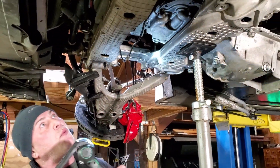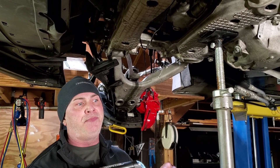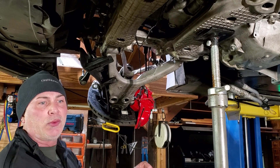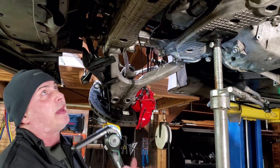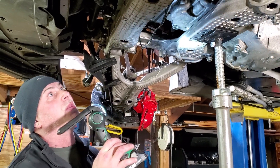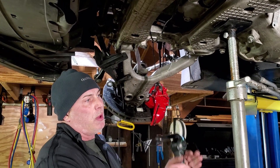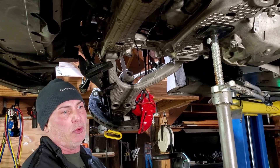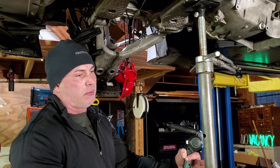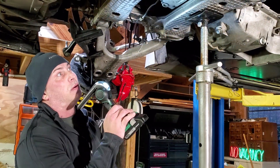With the steering rack moved forward, getting the crank pulley off is super easy. For the accessory belt — don't fight the tensioner. Instead, take the two bolts out of the alternator, twist the alternator a little bit, and the belt pops right off. I've done it a dozen times; that's the easiest way by far. To reinstall, put the belt on the alternator pulley sideways, pry the alternator back into position, run the lower bolt through, push the alternator up, and run the upper bolt through.